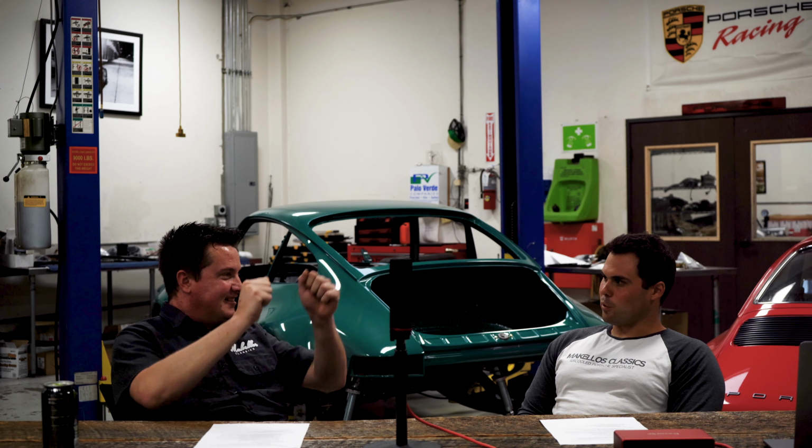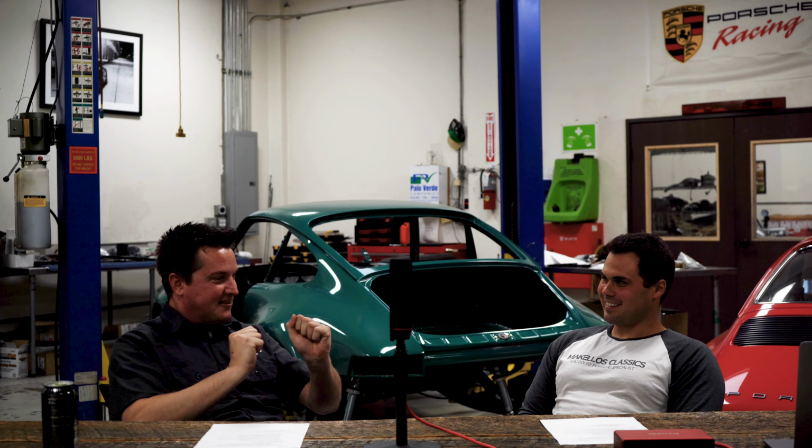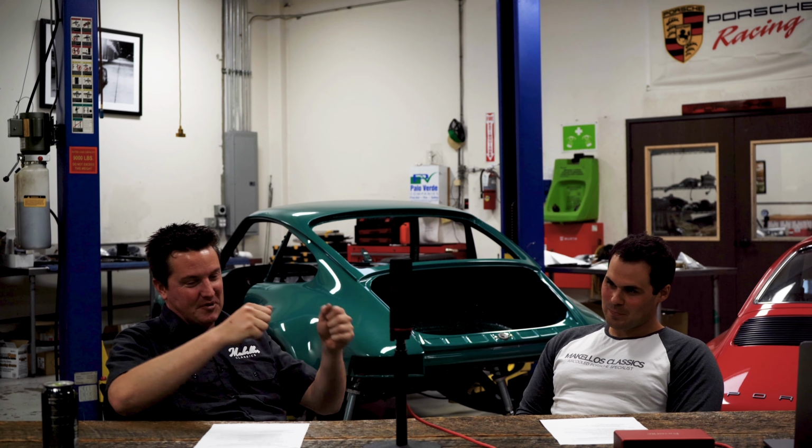A little stiffer, less deflection, less friction. It's self-lubricating because of that graphite, whereas polyurethane usually tends to like to grip or grab. And on top of that, we usually clearance our bushings as well, because people would just shove these bushings on there and make them work. You take these joints and they kind of click in various settings, and you want these things to be free moving. A lot of people order bushings that go with poly, bronze or thermoplastics because they look neat, but don't recognize that there's a level of maintenance that goes along with them.